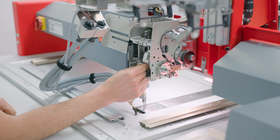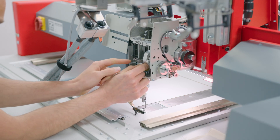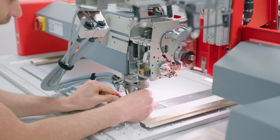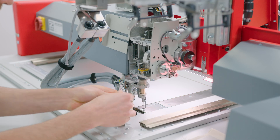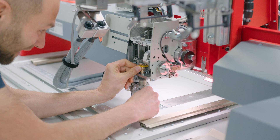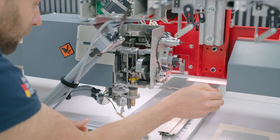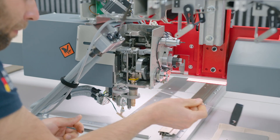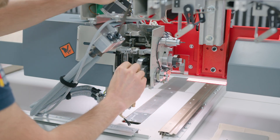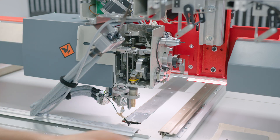Carefully pull out the pressure spring with two plastic bushings — be cautious as the spring is tensed. Loosen two set screws on the presser foot collar with a 2 mm Allen key and remove it along with the felt ring from the golden sleeve. Use a long 200 mm Allen key from the right side of the W head to loosen the screw holding the presser foot axis and pull out the axis.